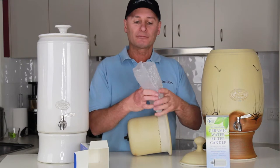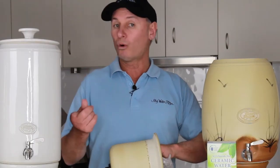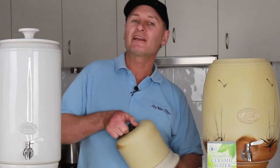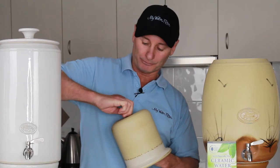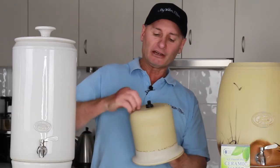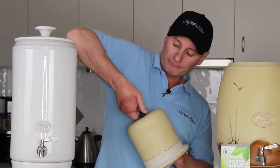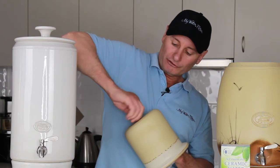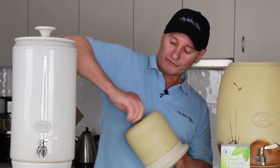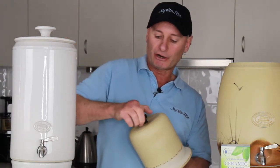Always get the bag, because I don't like to put my fingers on the candles. You get a lot of oil on your fingers, and we just don't want to get that embedded inside the ceramic candle. So we grab it, put the bag over the candle so I've got hold of it, and we're gonna undo the nut on the bottom — simply unscrew it. All the way off; it's a good lengthy little thread but it comes off very nicely. Just take your time and you won't have any worries at all.